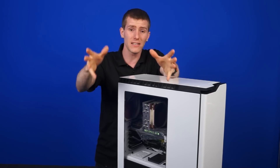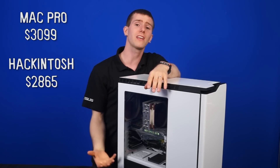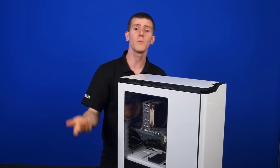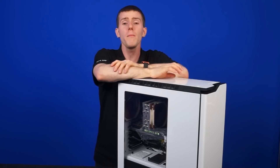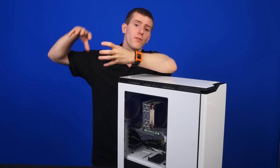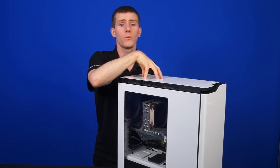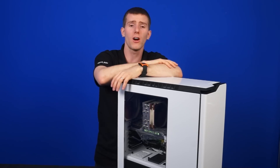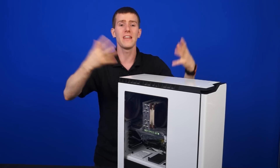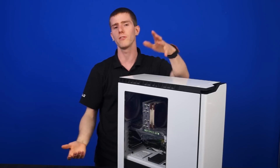It boils down to this: the Mac Pro is nice and extremely compact — a very sexy piece of hardware — also priced at over $3,000. Pretty pricey compared to the Hackintosh, with which you're getting significantly more powerful hardware and much better performance. You're also getting something that's not fully serviceable; however, the stuff you're going to be tinkering with is about as serviceable as a laptop, so RAM and SSD — the most commonly swapped parts — are easily replaceable. What you're getting for your money is that elegant design, the very small form factor, and the decently powerful hardware in the form of a quad-core CPU and dual GPUs. You are also getting workstation-grade hardware. The Mac Pro uses workstation-grade components including ECC RAM and is therefore inherently more reliable — though the counterargument is that if your graphics card dies, you can just throw a newer, more powerful one in anyway because you spent so much less on it in the first place.